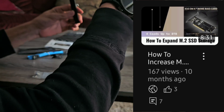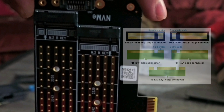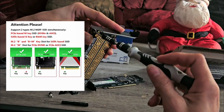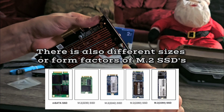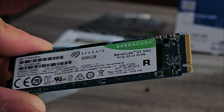What I'm going to show you is the difference between SSDs. There are two types: one that uses an M and B key, and one that uses an M key specifically for NVMe drives. All NVMe drives have five pins before the hole — called the M key. Any previous-generation SATA-based M.2 SSD has an M and B key, or just a B key. This is important to know especially if you want to expand storage, because on Amazon a lot of people were saying it wasn't working — they couldn't plug their SSD in — and that's because they were using the wrong SSD card.